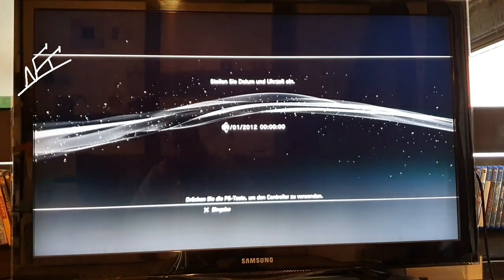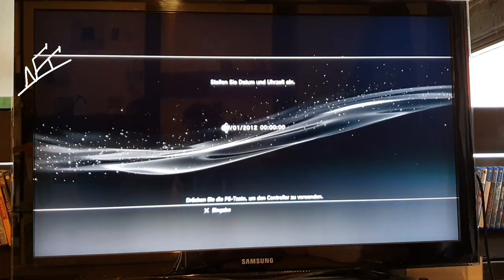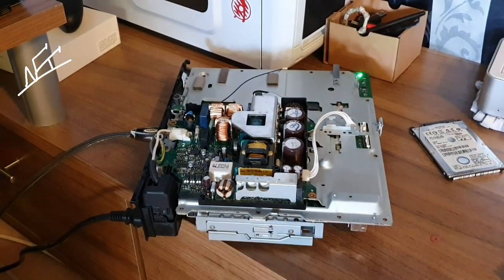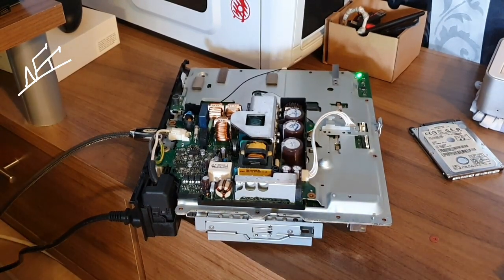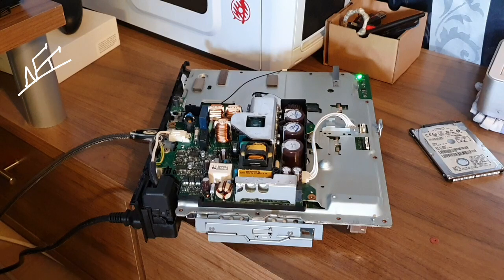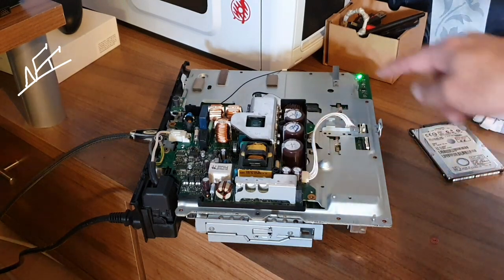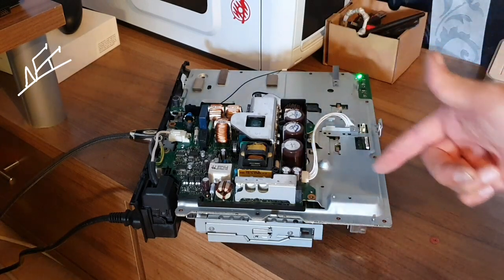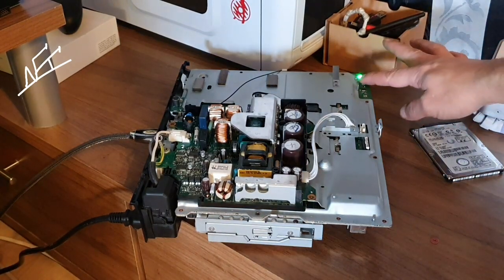You're welcome on my channel — I hope you subscribe and I wish for thousands of thumbs up for this stuff. A great working PlayStation, repaired with a newer, better NEC Tokin capacitor. You can see the capacitors normally all work great, but when the PlayStation gets hotter and hotter over time, the capacitors near the CPU and GPU get broken too because they sit in the heat. The next components sitting near the CPU and GPU get very hot too.